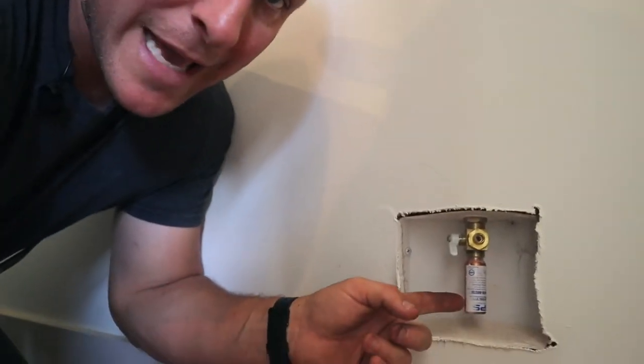This little copper canister controls water hammer. That way, if you have a surge in water pressure or you turn your main water off and back on after a repair, it won't surge inside the refrigerator and bust those components. The components that hold water inside the refrigerator are not very strong and they actually bust pretty often, so you definitely want to add this if you don't have one. Now that we've confirmed those two components are going to fit and work perfectly, all we have to do is hook up the line.